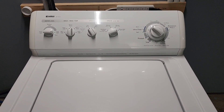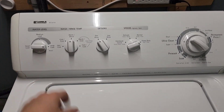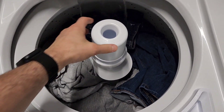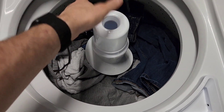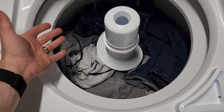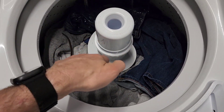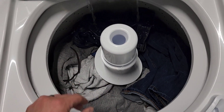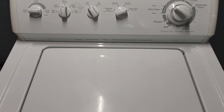Today I have a matching Kenmore washer and electric dryer set, the direct drive style with full water submersion and an agitator. The agitator turns freely in one direction but not the other — if yours spins freely both ways, it's not working correctly. As it fills with water and agitates, it vortexes clothes along the agitator fin down to the bottom, where four fins push clothes out against the outer wall, creating a vortexing cycle that does an excellent job getting clothes clean.